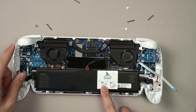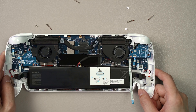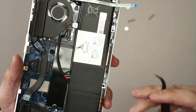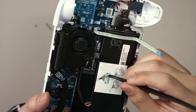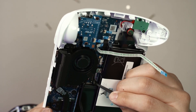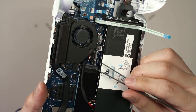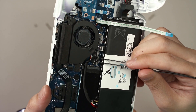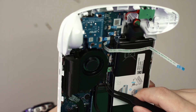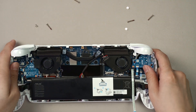For the battery, you just have to pull out the tab and then you can lift up the entire connector. It's a bit difficult to get into because it's nestled here, so I will use a pair of tweezers. If you're going to do this to your own device, keep in mind that I'm not responsible for any warranty issues. You can see this little metal tab — pull it out, and then the whole connector can be lifted upwards.